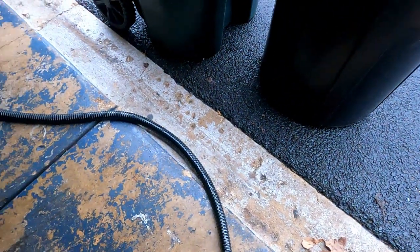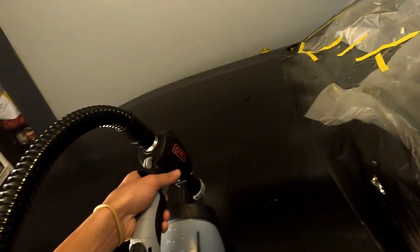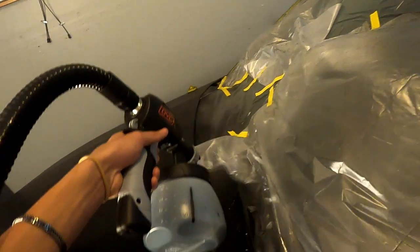We're gonna spray it thicker than last time. So here we go. As you can see, I'm laying it on a lot thicker than the first coat. Or at least I'm trying to. We want the dip here to be like a wet sheet. That way it dries out evenly and does not leave any sort of spots at all. In this one, you really want to focus on those 50% overlaps in your passes.